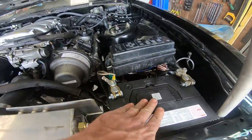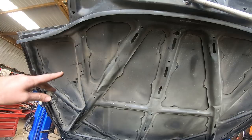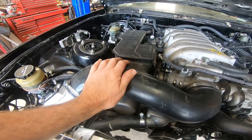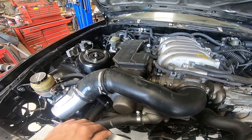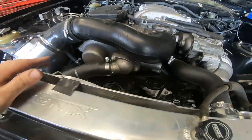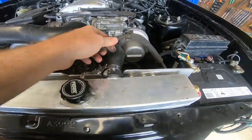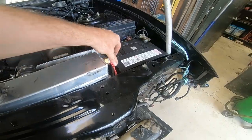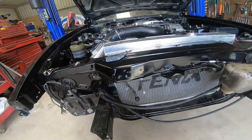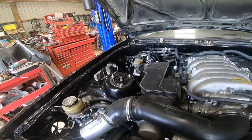There's a new bracket to be made for the battery. On the bonnet — it actually fits apart from this bit here fouling on the factory intake, because we've chosen to leave the factory intake on it. So we're probably just going to trim that shroud of the bonnet. The cooling system has bled up. However, I've left the overflow bottle off when it's cold because I don't want it to suck the crap out of the bottle until that's cleaned. There's a cooler to go on the front for the oil cooler and power steering. The power steering has mostly stopped winding and sucking air, so that's bled up.